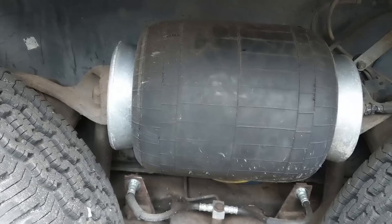Now let's talk about other mechanical issues. The biggest one is the fuel filter — I think. When I'm at 85-90% throttle, everything works great. But as soon as I floor it all the way, it does this vroom-vroom-vroom thing — it seems like a fuel issue. Maybe it's the fuel pump or the fuel filter. The fuel filter is pretty easy to replace, so I'll do that in a later video.